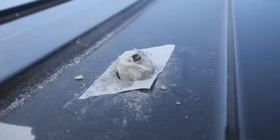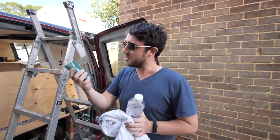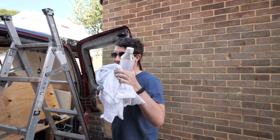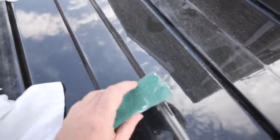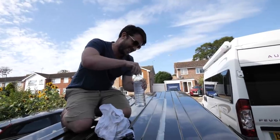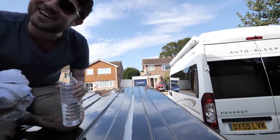They say hello to each other through the freshly drilled hole — it's done! It's now Alex's time to shine: he gets the honour of cleaning and prepping the roof ready for the solar panel. He's going to sand a bit of the roof where it's going to go so the glue has somewhere to stick to nicely, then clean it with some white spirit. You can see it's just roughing up the surface — it seems so wrong to scratch such a shiny lovely roof, but it'll stop the mean comments!